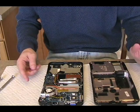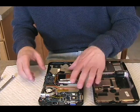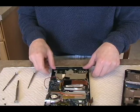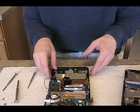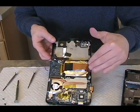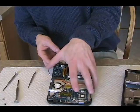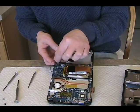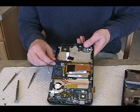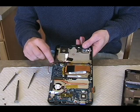Let's get to the good stuff — the RAM. The RAM is actually going to be underneath this other motherboard, so we're going to have to take this off as well. This is certainly not as easy as the prior Q1 series. There is no RAM module visible here — you've got your hard drive, the CPU under here, fan here. I've already taken out some screws and removed some wires out from underneath the tape. I've also removed the rear facing camera right here with one screw.